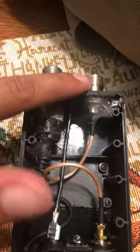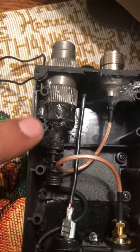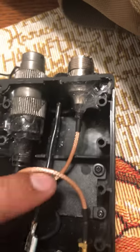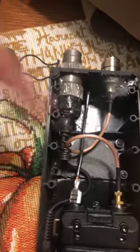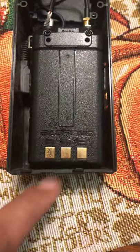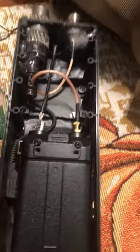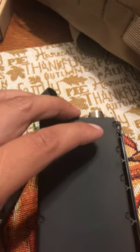So this is the extension — you can reroute your antenna. You're going to have to drill some plastic from the side. I dremeled some plastic on this side, notched it, and went through the bottom so this piece would fit. When you begin to try to do it on your own, you're going to see what I'm talking about. You're going to have to dremel all that stuff. And on this side too, there are some notches on the bottom of the radio which I cut and dremeled out. When you try to do your own modification, you'll see what you need to dremel out. I just wanted to show you some of the products you're going to need if you want to do something similar.